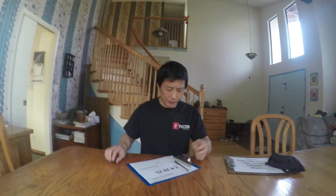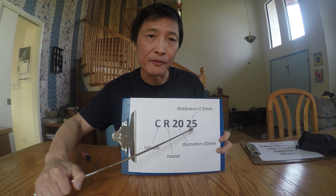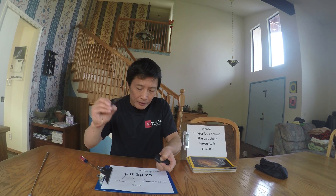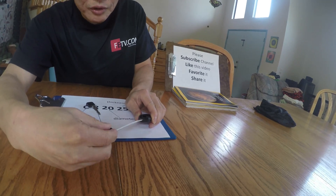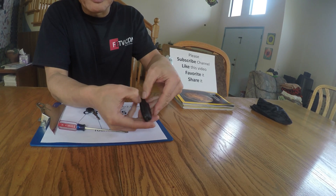Let's see how we replace the batteries. You need to check your user's guide. This is the type for my car — around 20mm in diameter and 2.5mm in thickness. You can have a little bit thinner or thicker one as long as it will fit. Some remote keys need a screwdriver, but this one doesn't. You open it by pressing this and taking out the key. There's a little slot here — use a flat screwdriver to pry it open, then use a fingernail to go around the perimeter and open it all.